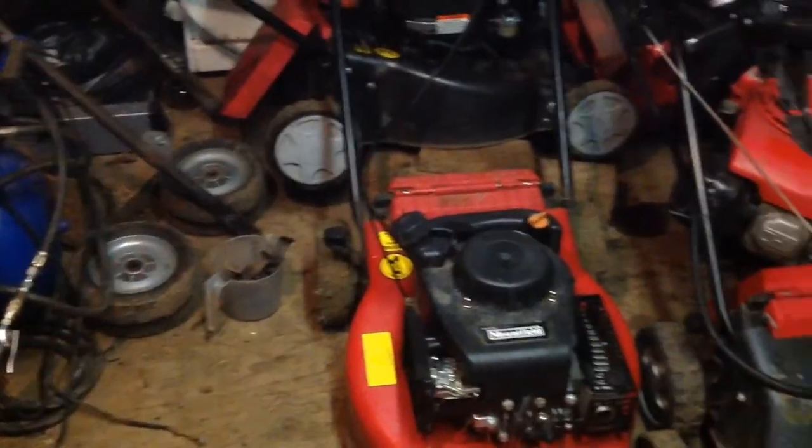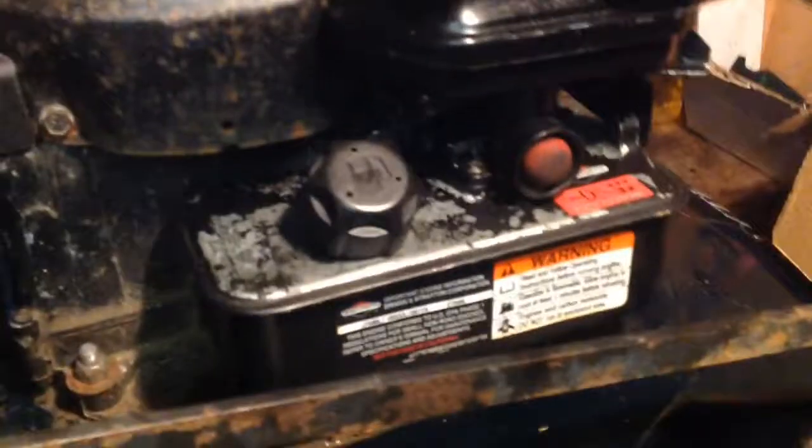Hi, I'm back again and I've now collected all the mowers I bought and I'm getting quite chocked now with mowers. There's one I got, it's a Hayter. They said it didn't run great, it sort of runs on choke so I'm tackling it with the diaphragm in the carb. I've got another one ready to swap straight on there so hopefully that'll solve that one.